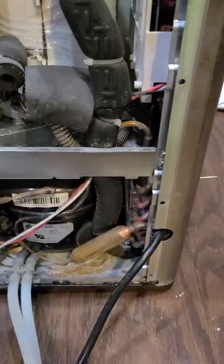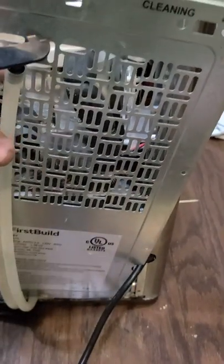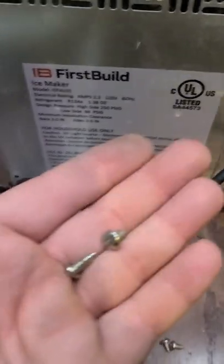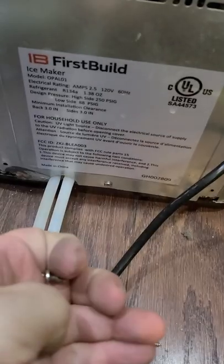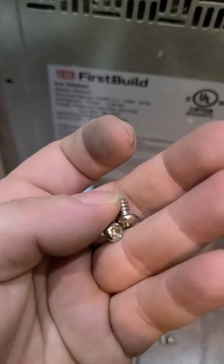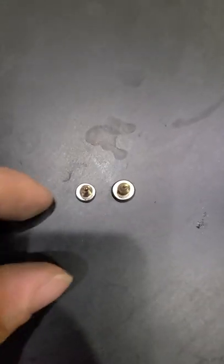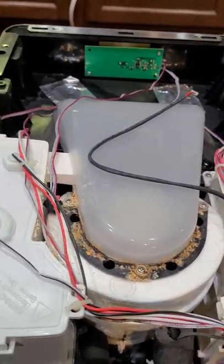This thing just twists right off — no big deal. To get this cover off, you just lift it up and pull out. You can see the clips in the back. It is important to note that you have two screws that are the same length and thread but they have different head sizes. I lined them up on the black plastic so you can see the different head sizes. This smaller one goes into the black top; this one goes onto the back panel or that corner.